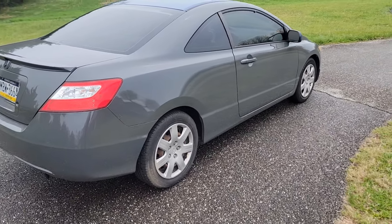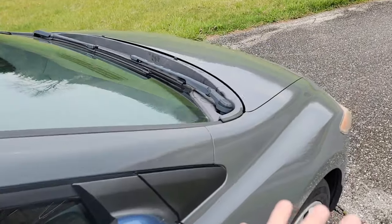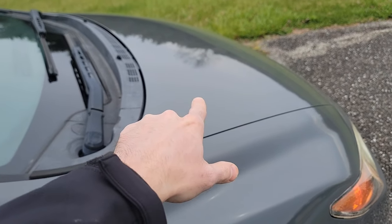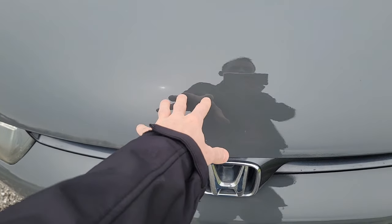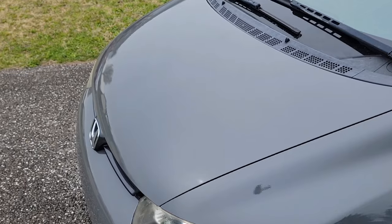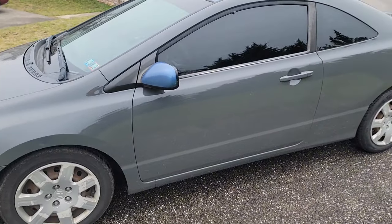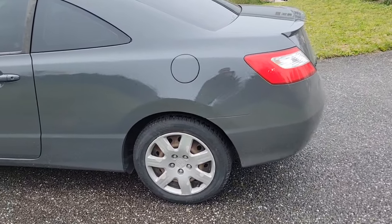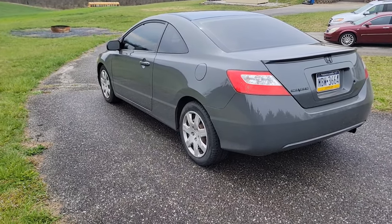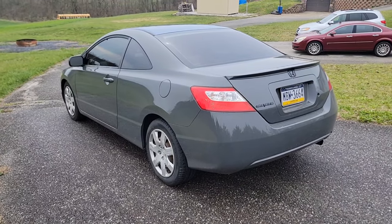I put the clear coat on really heavy because I knew it was probably going to get sucked in and dull out a little bit. Basically what happens is because there was so much peeling clear coat, it kind of sucks that in and you'll start to see the outline because I didn't sand it completely — the hood is really the only spot that does that. I also put the clear coat on the hood really, really heavy, so there's a lot of clear coat on that hood to wet sand and buff. I will be wet sanding and buffing this whole thing, and I want to paint the mirrors and roof black to finish out the car and do something with the wheels. I think overall it came out pretty nice and for $800 I really can't complain. We have a couple more projects coming up with this car — I have to replace the front struts and some other things. If you guys want to follow the journey, hopefully we'll have another fun car sometime soon. Thanks for watching.